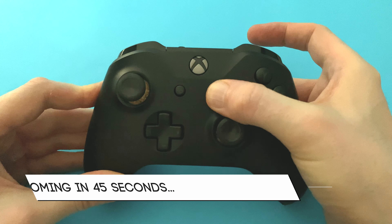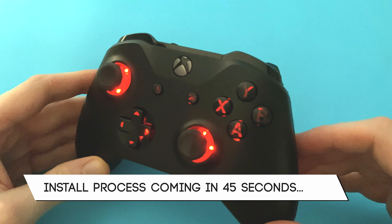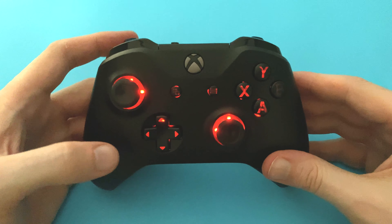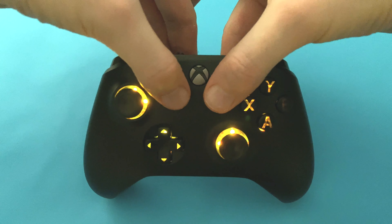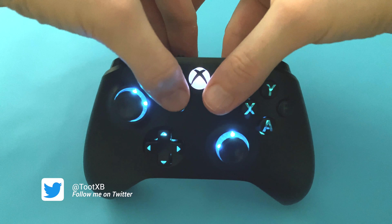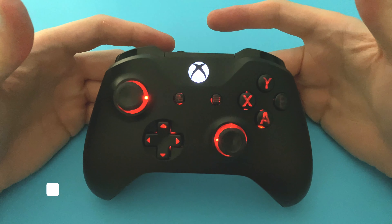And here is the finished controller. As you can see after the install the B button is not working. I put this down to maybe an LED being out of alignment, however when I opened the controller up and had another look it all went wrong for the B button when I wrapped the circuitry around the main board. It was slightly out of alignment and the wrong part of the circuitry was covering the connection for the B button, so it just wasn't making contact. I fixed it and here is a picture of the B button now working so that you can see the kit actually does do what it's supposed to do.